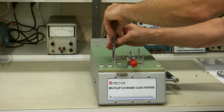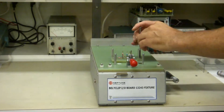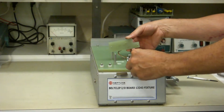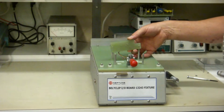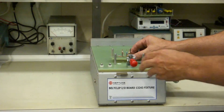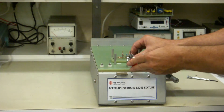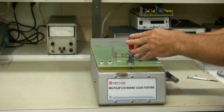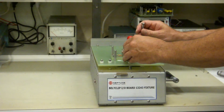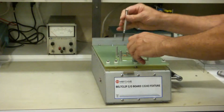Now you have total access to the wiring. To remove and replace test pins, you remove this board right here. Now you have full access to these test pins, and you can also close your lever latch, look down, and verify that the holes are aligning with the test points — just by looking down the holes it's nice and easy to verify. When you put it back together, you need to lift this up; otherwise the pin pressure is going to fight against you. So lift it up and then drop it in — it falls right into place — then tighten the screws down. Make sure it's all the way seated and make sure no wires fall underneath it and get pinched.